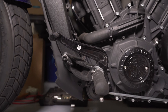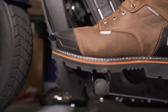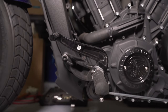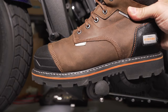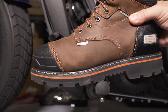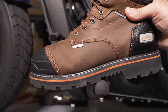One of the things that is easily adjustable is your shifter. If you have boots that are really deep and thick, such as these Herman survivors, you are going to need a lot of space underneath. If you're coming across and always hitting, this needs to come up. If you have too much space where you find yourself having to flex your foot back really far, this needs to go down. It's not just shifting up — think about shifting down too.